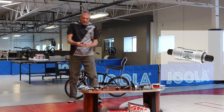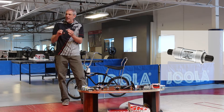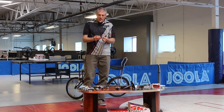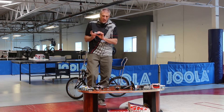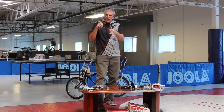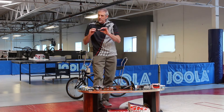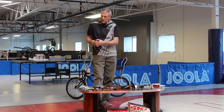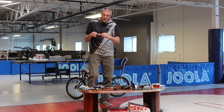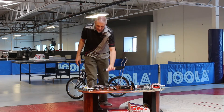From there they realized they could make the spindle a little bigger and hollow to lighten it up. So they went with a splined system rather than the square taper — still a cartridge bottom bracket. This crank has splines that match up and go onto the crank. The problem was they had to reduce the bearing size to accommodate the hollow spindle, and over time these would wear out very quickly. It wasn't necessarily a fantastic design.